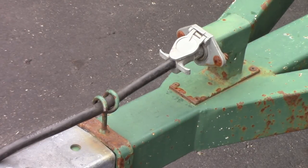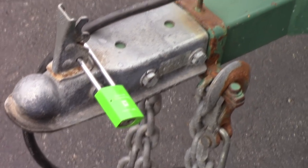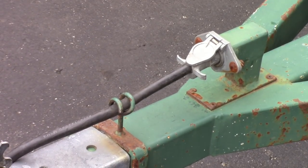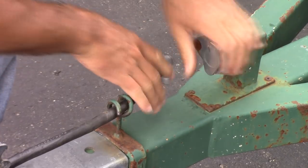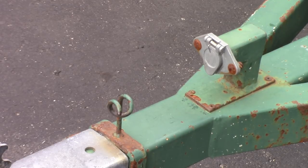Not too sure if this applies everywhere in the world, but it does in Ontario. Now, what you're looking at right there is on the tongue of the trailer — I made my own angle piece to go up, and you can see it comes out of the electrical connector, goes through a holder, and comes down to the end of the hitch down to your cable. The reason I wanted to do that was I wanted to be able to take it apart. This comes off very simply — just undo this, and now you can take your cable away and it's not sitting in the weather.